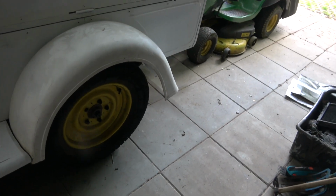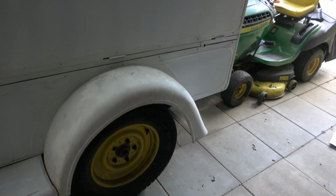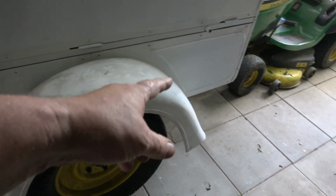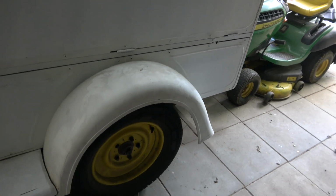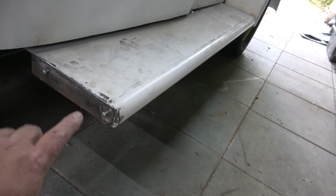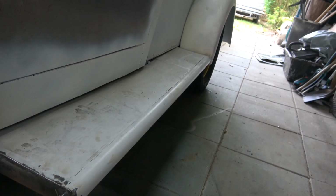As I say, these are the original wheels, but they won't probably be going on it. If it means widening the arches, then there's no problem. It's only a matter of cutting down the centre and letting in how much steel we need, and we'll go from there. But this is as solid as a rock, this, and that's been made out of half pipe, as you can probably see there. Yeah, you can see on the edge, it's just a half piece of pipe. And then it's got a framework inside it, box action inside it.